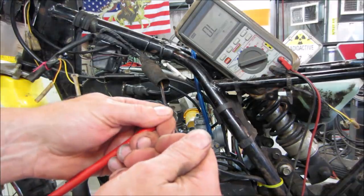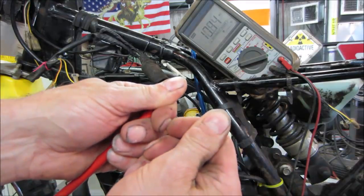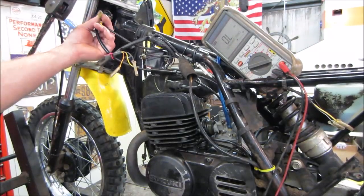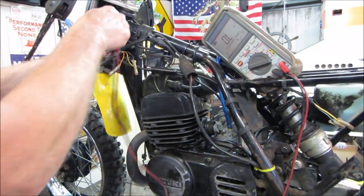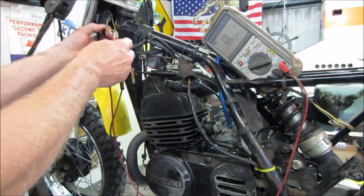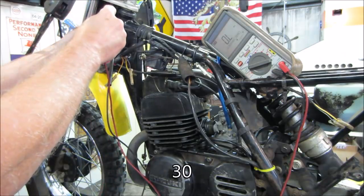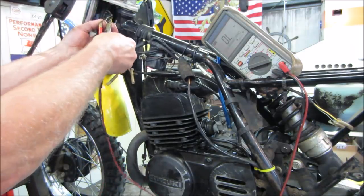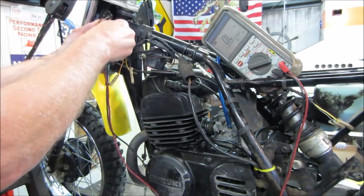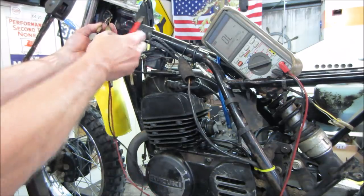If you put your fingers on it, see if it'll do it if my hands are wet enough. There you go. So if your fingers are on the leads, it'll screw up your numbers. I'm going to buzz across the headlight too, and see if the element is any good. This is a 40-year-old bike after all. Let's get rid of that. I don't think that's supposed to be there. Yeah, it's open. We should get like 6 ohms across the bulb. Yeah, so that bulb's blown anyway.